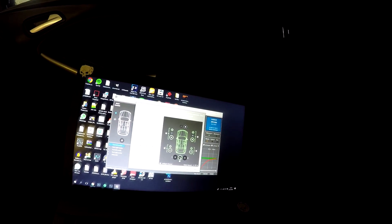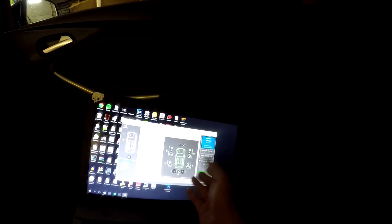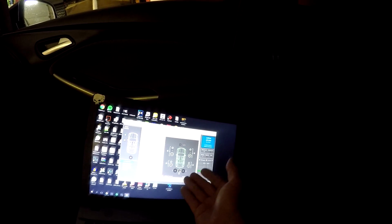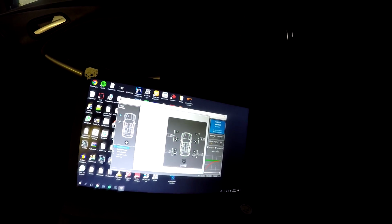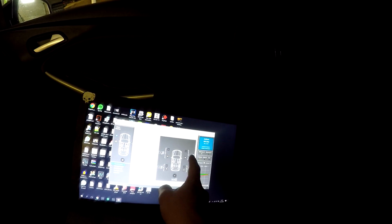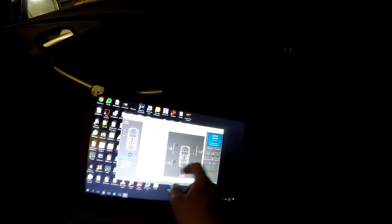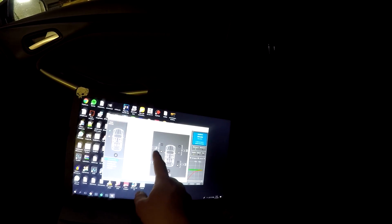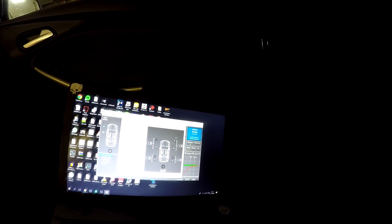Sorry about that. Now we don't actually have a subwoofer here, but I will set it correctly anyway, because if you want to add a subwoofer, you just connect it to the speaker output and you don't need to make these settings anymore. So we have 1, 2, 3, 4 channels and a fifth channel for the subwoofer. We go next and select that one is front left, 2, 3, 4 and subwoofer. These are set by the wirings at the amplifier, but we always put the first one into front left, then right front, and then the back speakers.